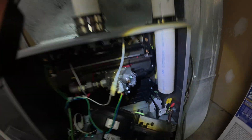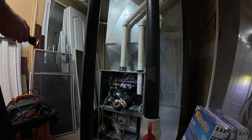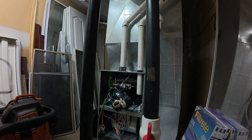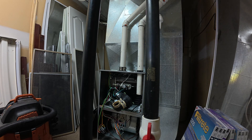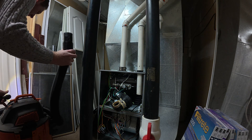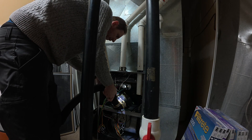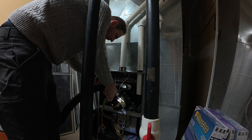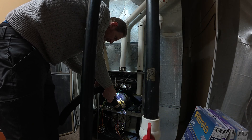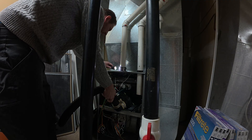I get the shop vac. Having looked at other videos and talked to the repair guy last year, I thought before calling him out I'd do the basics — make sure there's no water in the system that could affect the pressure switch. So here I am with the shop vac sucking the water out of the fan motor and exhaust fan motor.